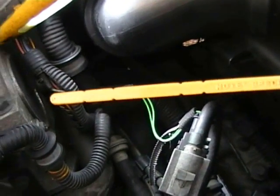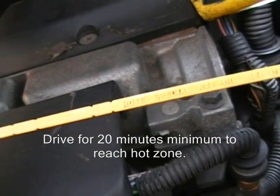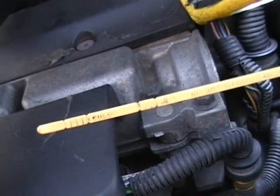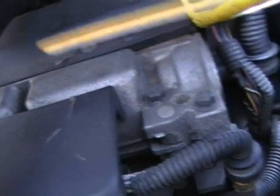So the day before you do this oil change, get the vehicle up to temperature by driving it for 20 minutes or more, and slide through the gear selector, stopping at each designation on a flat level surface, and then return it to park. You then use the dipstick to check it on the hot level. This is the only really accurate way of doing it.